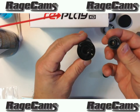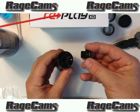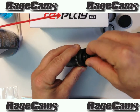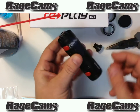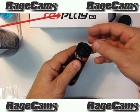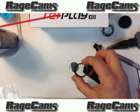We've got many different lenses that will fit this camera. Some might stick out just a little too far, and if that's the case, we'll need to use an O-ring around the camera. To thread in the lens, go counterclockwise a little bit until you hear a little click and make sure it's threading in properly, then go clockwise and keep threading it in. Then we use an HDMI monitor to aim it and focus it — pointing out a window at objects 100 to 200 feet away.